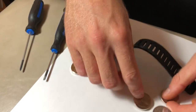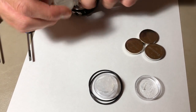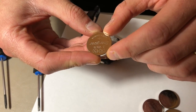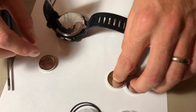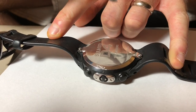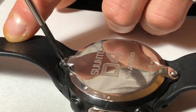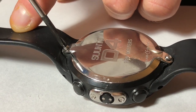I ended up buying a pack of three of the wrong ones and wasted about ten bucks and a few weeks waiting for them. Make sure when buying online that you buy from a source that says right in the description that it will fit your Suunto D4 or D4i. I got the right one on eBay. Now we're ready to take apart the back of the watch. You'll see the screws — use a Phillips screwdriver and make sure it's not too big or too small or you'll strip the screws. This one fits nicely, nice and tight.